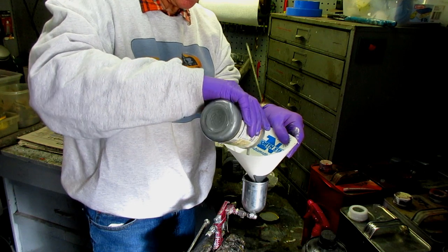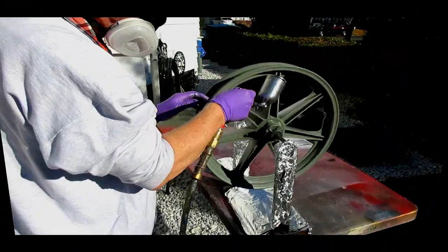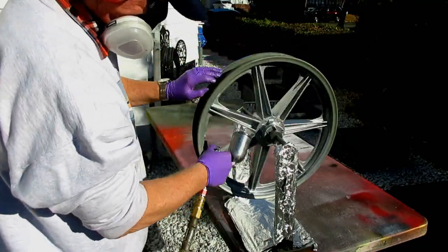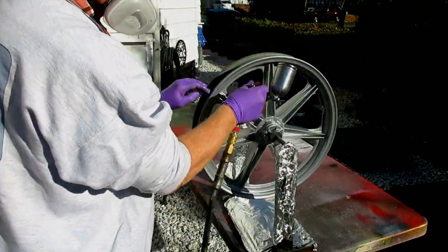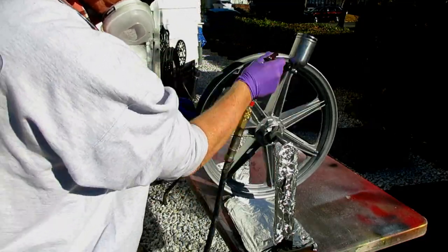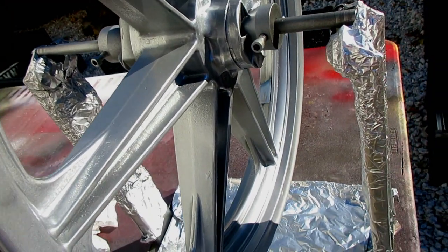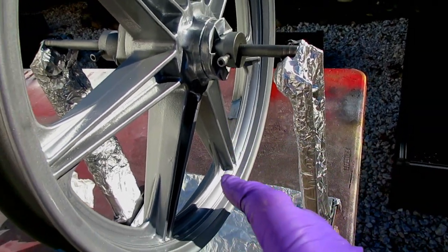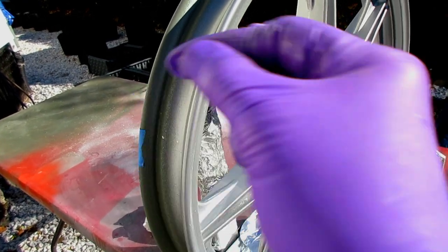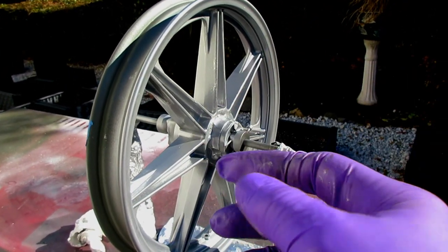Because this is paste pigment, I want to make sure I don't put any chunks in — they wind up in the gun. As I was spraying this, I was noticing right away it covers just like regular paint. The advantage, if I can do this, is I would also do the priming in gray primer. The idea with painting a wheel is around the edge — you don't want to get the paint thick, so when you're mounting a tire, the edge doesn't peel it up or chip it. So if this dries and it's durable, I'm going to put it to the test.